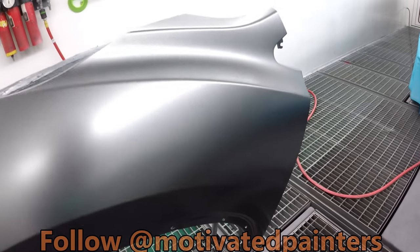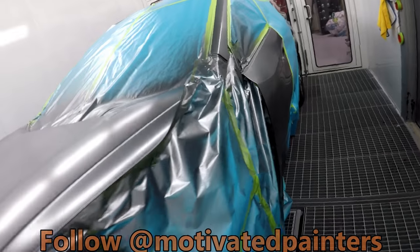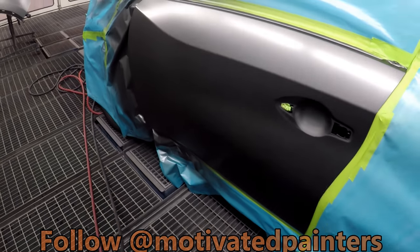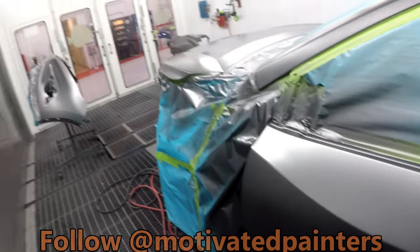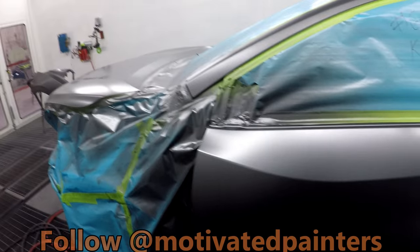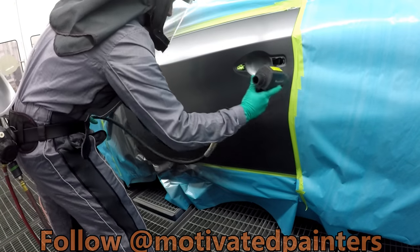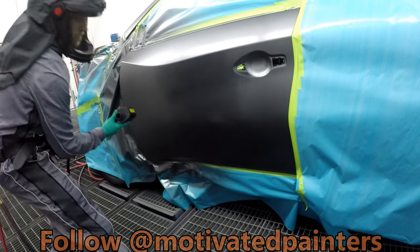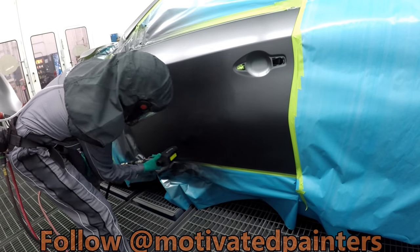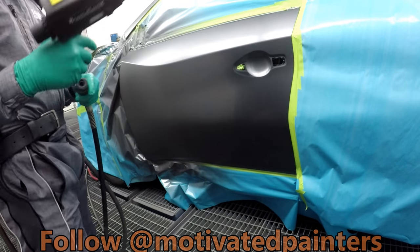The coat with the T490 and extra reducer evens things out nicely. Now I'm gonna do a double control coat. This color is a nightmare. Just the way that it lays down is super difficult. So I thought I'd make this video with this color and hopefully show you guys something. Eighteen PSI.